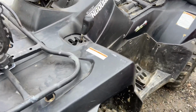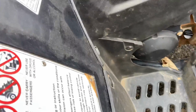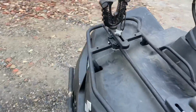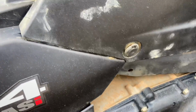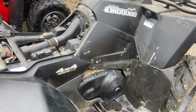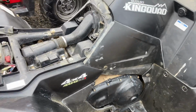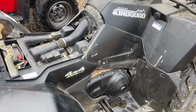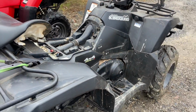Changing the oil, okay? It's a pain in the butt. You got to pop off these side covers. Plastic tab. And I believe there's normally a screw in it, but I replaced them with plastic tabs. Yeah, look, plastic tab. None of them went back in right. Plastic tab. Okay? And then, to get to your oil filter, after you take off all those plastic tabs, it's in the front, in a very tight spot that you can't clean up before you pull it out so you don't get dirt in it. It's a round cartridge filter thingy, whatever. Very hard to get to.